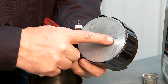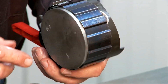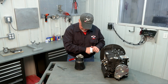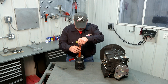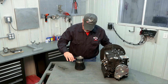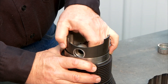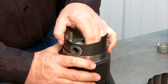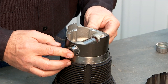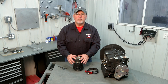Now on the top of the piston there's actually an arrow. That arrow, when we install the piston cylinder onto the engine, will go towards the flywheel end of the engine, so we can pre-orient that a little bit. You can turn these in the cylinders if they don't get oriented properly while you're installing them — it's easy to realign them. I'm just going to use my hammer handle here and give that a little bump, right down in there. I'll remove my ring compressor. I'm a little bit deeper than I want to be — I'm going to work that back up until I can push that piston pin through there by hand. So now I'm aligned properly and that piston's ready to go in that cylinder. Just repeat that process with your other three cylinders and you'll be all set to assemble your cylinders onto your engine block.